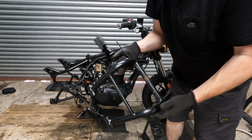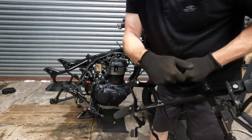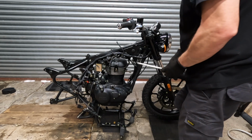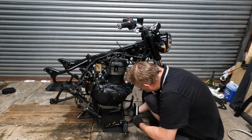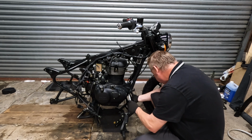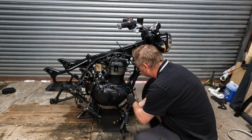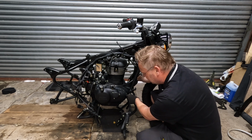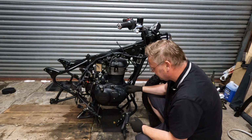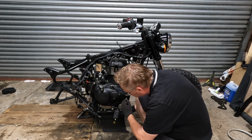If you remember, we took the under cradle off for better access for cleaning. So let's pop that back on. In the excitement to take it all apart, it's easy to forget where everything is. Right, so let's go front first. Only because that bolt's to hand. I'll just do this loosely for now, and I'll put some grease on that later, because steel bolts just love to seize in alloy cases. Lovely. Ooh, that needs to be there.